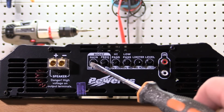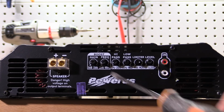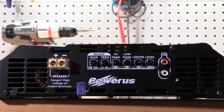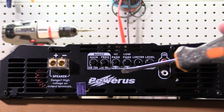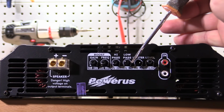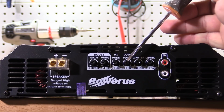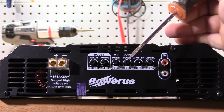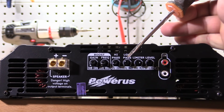Of course, you have the dreaded bass boost, which you can also adjust the frequency at. Just be like me, knobs left on this part here. You have a high pass filter, which is really your subsonic filter. It's adjustable from 5 hertz to 200 hertz. You have a low pass filter, which good luck dialing this bad boy down. I would say leave this one knob left as well, because that would do 80 hertz and below, but it just goes to max. So if you can fine tune this from 80 hertz to 20 kilohertz, God bless your soul, because I don't think I could do that.